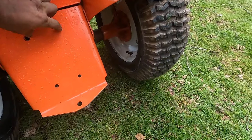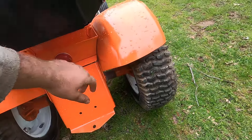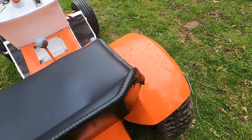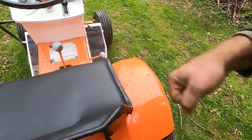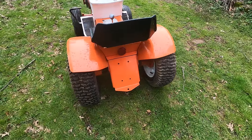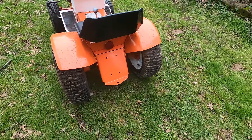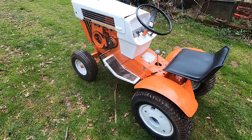These were made by Roper and distributed through Sears — you could buy them through the catalog, send out the magazine, look through it, and place your order. I believe this one here is a later model, like 1970 or '71. It comes with a 12 horsepower Tecumseh engine — they're a good motor, a lot better than the stuff you can buy today, though I still prefer a good old cast iron. It's got the starter-generator here, belt drive to the engine, so that's electric start.